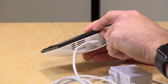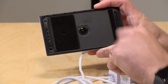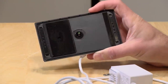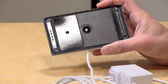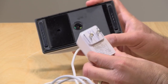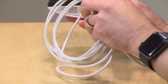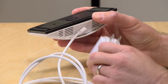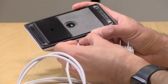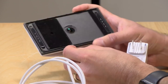There's also a little rubber curtain around the edges to help keep the light out. You will see in a few minutes when I show you image quality samples that there is a little bit of light bleed on the edges, but by and large it looks pretty good. Because it sits inside, it needs to be powered all the time, but it's obviously going to be easier to get to an outlet. There's a nice long cable for the camera — it's a 9-watt power adapter running at 5 volts, 1.8 amps, so you could probably find other ways to power it. The barrel connector is removable, so there is some flexibility with that.